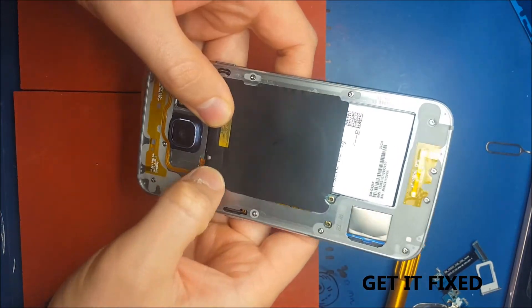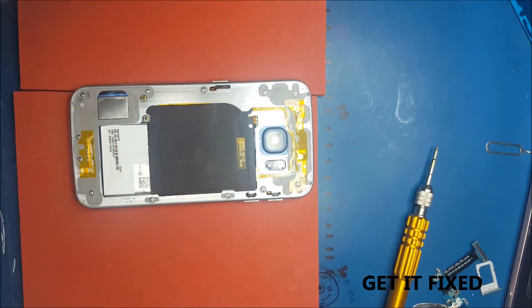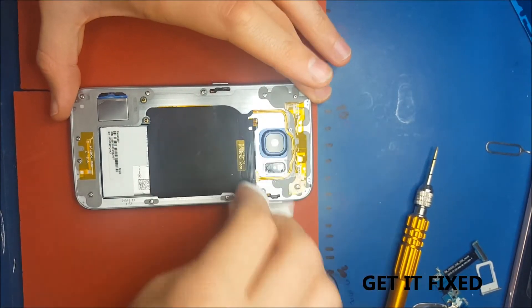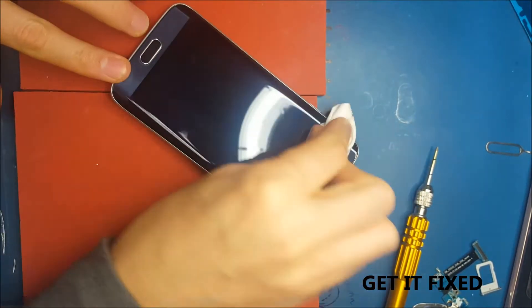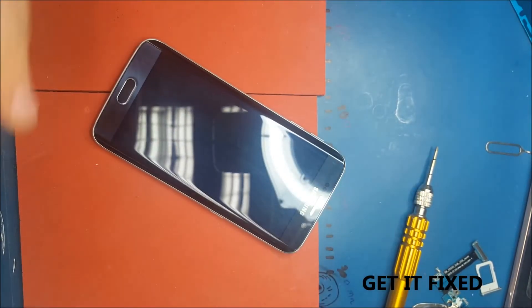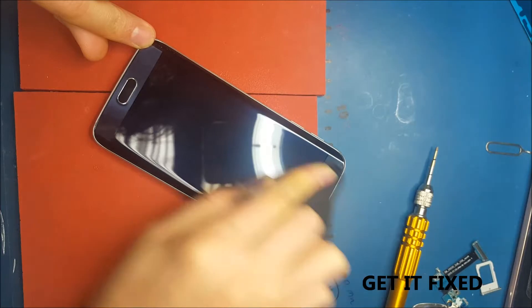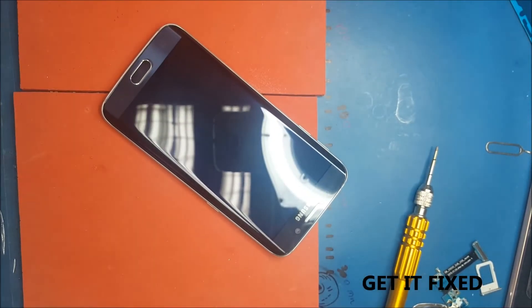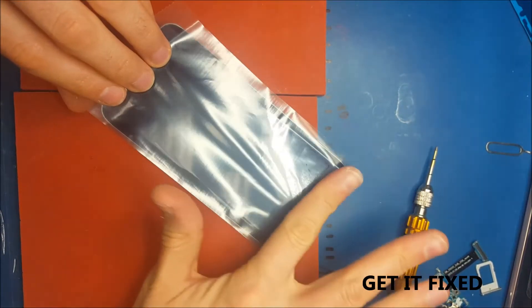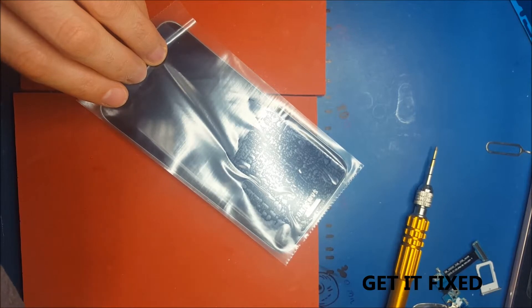So, because this bezel is quite new, you don't need to clean anything. If you want, just clean the dust — that's it. But if you were using an old one, you have to make sure there's no glue left around, because otherwise you won't be able to fit the back glass properly back in. So what I'm doing now is using a simple solution to clean the fingerprints on the LCD, then put a special foil — it's just a simple protective foil, it comes from China. I'm using this foil just to protect the LCD, because in the process you can get a lot of scratches, even minor ones on the glass.